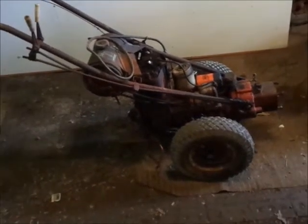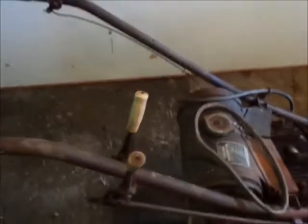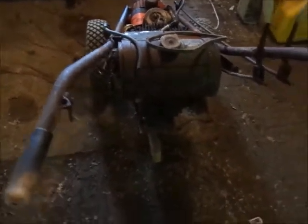All right, guys, so I got the 63L8 or the Phoenix in the shop here, and I'm going to start addressing the issues that I found in no particular order. I'll rhyme them off here. The starter clutch not functioning right, which more than likely fried the cams in there, because it got hot enough to melt the governor, which was right beside it, and the carb was also melted completely.